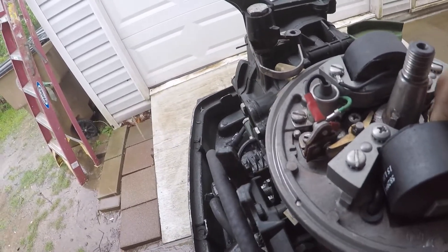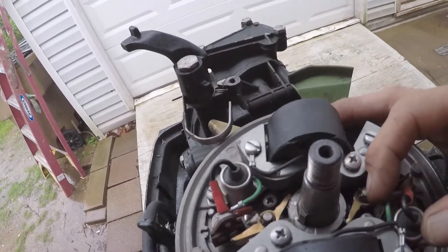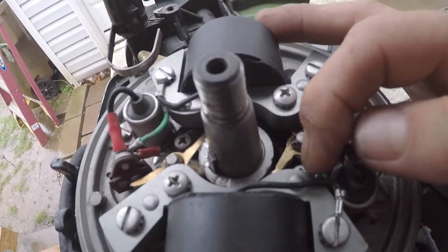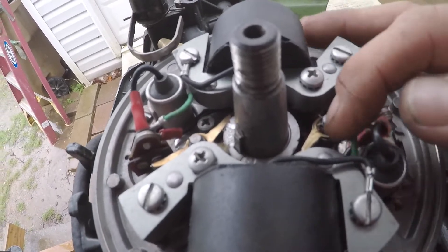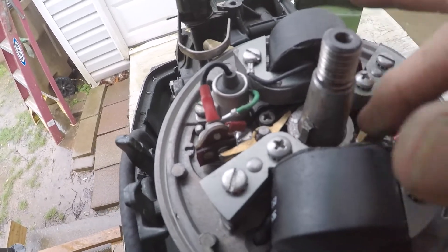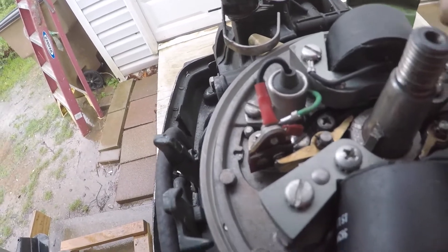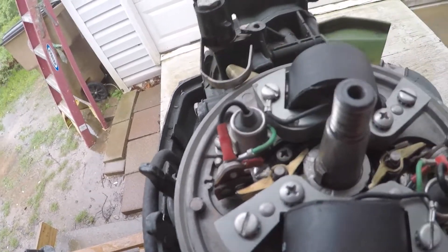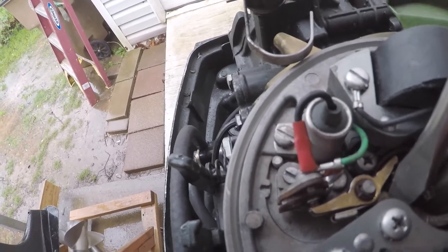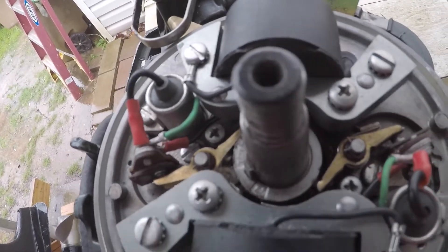This one's got plenty of clearance — this wire, the green wire. What I had to do was just kind of loop it up somewhere out of the way. You just want this much clearance for the flywheel. And make sure over here that your wiper is kind of tucked in there so that it won't get into the flywheel as well.